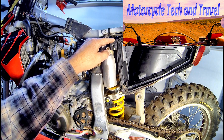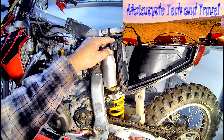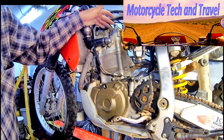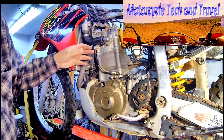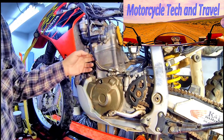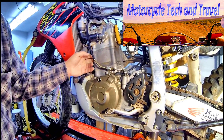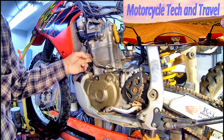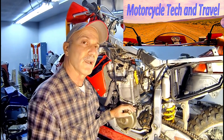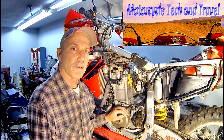At this stage, the next thing to do is tear the upper engine down and find out the extent of the damage. Our next steps are to remove the rocker box and camshaft, remove the cylinder head itself, and remove the cylinder — which we know is damaged from visual inspection. We now know that the valves are leaking as well. Stay tuned as we move into rebuilding the upper end of this Honda XR650R — we're going to rebuild the top end, restore full capacity, and build horsepower throughout the top end of the engine.